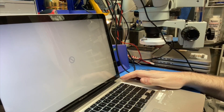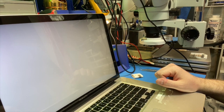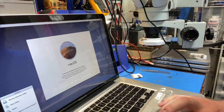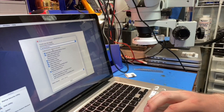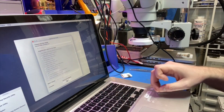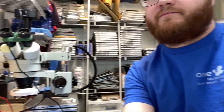The installer is finished. Shutting down and booting back into the USB to do the post-install patch. From the utilities menu at the bottom there's macOS Post-Install. Select the model — the detected model is MacBook Pro 8,2. Select the volume we're installing on, Macintosh SSD, and hit patch. There we have it — macOS Mojave installed on this 2011 unit.